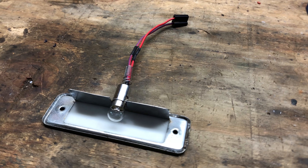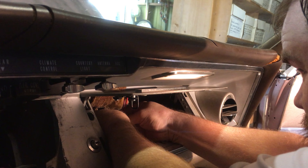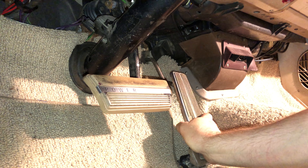I'd previously replaced my courtesy light with an LED but didn't like the color. I did it because these lamp holders always crack the insulator. I fabricated a new insulator out of heavy plastic, cut the wires, brought them through, and reconnectorized them. Here's the finished incandescent product. The courtesy light wiring to the glove box is in a two-terminal connector in the dash, which pushes together. With the glove box opening replaced, I was able to move on to the other components.